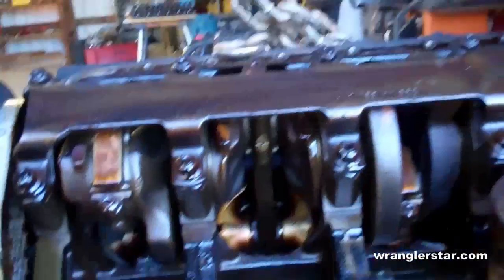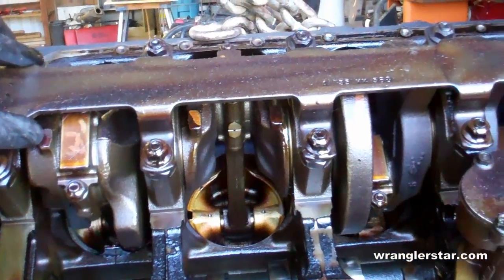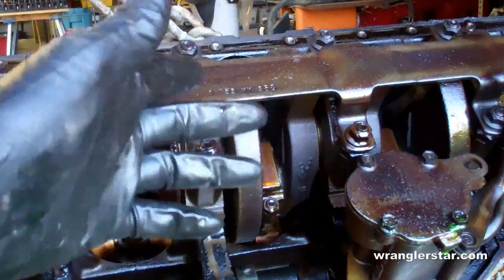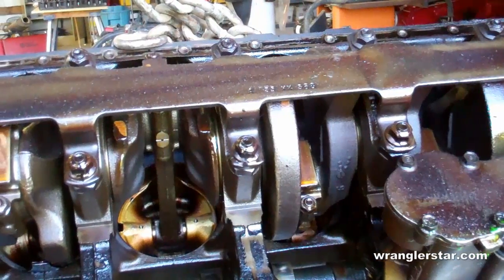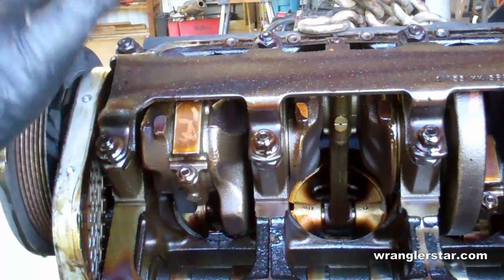And then we have right here the crankshaft cradle. On these long engines they have long crankshafts and they can tend to wobble at high speed or high RPMs. That's really bad — it'll break the crankshaft. Some of the old early engines 100 years ago, like straight-eight engines, had real problems with that. They just are not high-revving engines.